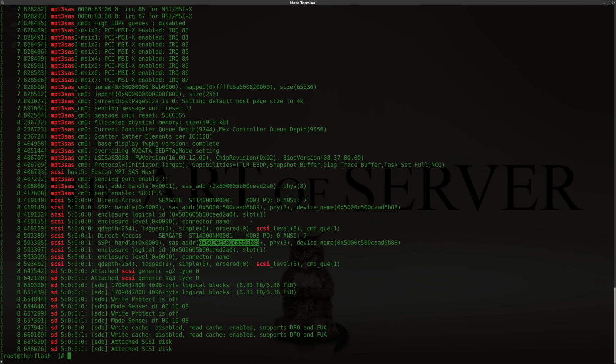And so here's the SAS address that's associated with that. You'll notice that this is 5001, 5000. They're the same SCSI target, so they have the same SAS address here. But the last number, which is the LUN number, or the logical unit number, is different. The way Seagate is implementing the access to the 2 halves of this Mach.2 drive is by presenting them as different LUN numbers. The first one is LUN0 and the second one is LUN1.